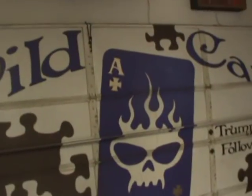Should I slick sand this whole car? Not in my opinion, no. Because if you slick sand or high build a whole car, you are going to have to finger those edges to death. And at that moment, because I've done it, you're going to think, damn, I wish I went high build primer, everything, man. Not in the nooks and crannies. Been there, done that, didn't like it. There's a time and place for everything.